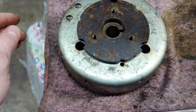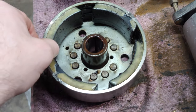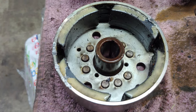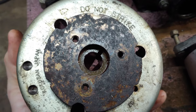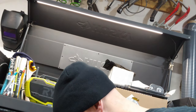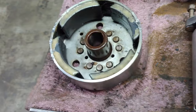I had to beat the crap out of this flywheel to get it off. A buddy of mine gave me a suggestion — he told me to use automatic transmission fluid mixed with acetone. I had the bolt off, stuck it in there, and let it soak. I put the sled up on its side so it would fall down in there and let it soak for three or four days, keeping it at 50/50. I went through three sets of puller bolts — they're only 6mm but they're 12.9 hardness — and the flywheel wasn't having any of it.